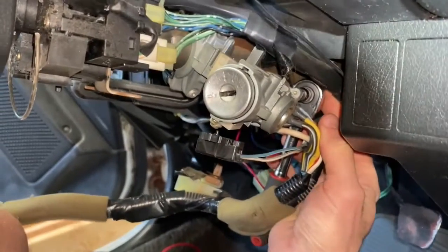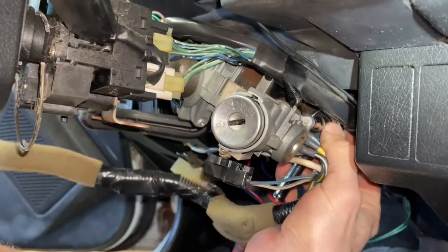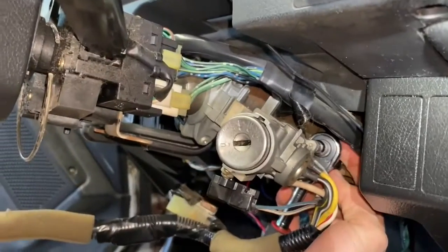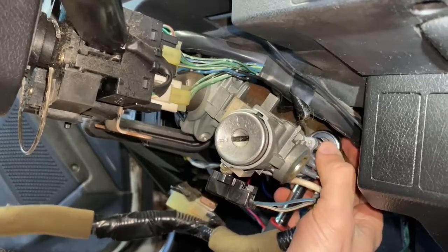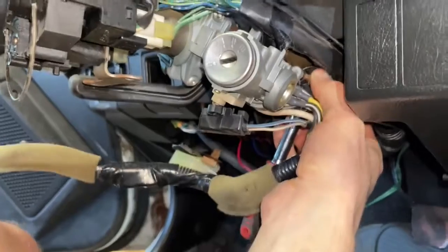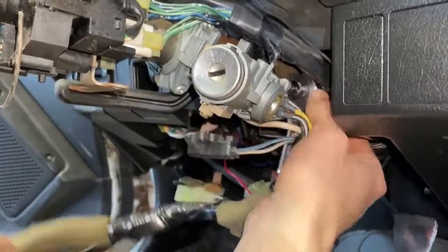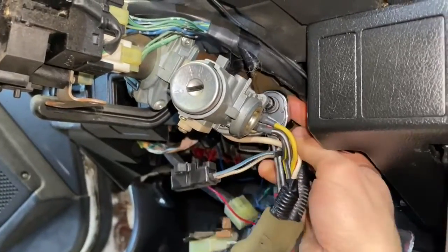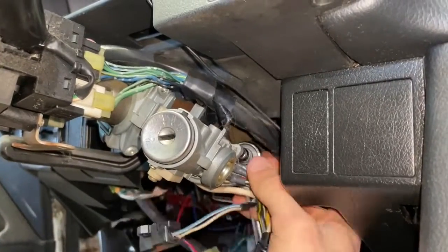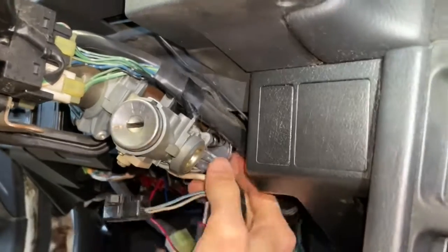This is the setup I have to get access at that screw. A six mil socket on this thing — if you have to figure out how to get in there with a Phillips, I'm really sorry. It's definitely a pain to get at, but once you get it, this thing's already broken free — you can hear that clicking. I'm just going to keep working this thing off and then we'll get that new ignition switch on.